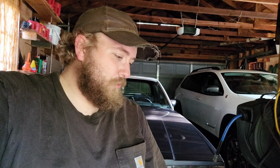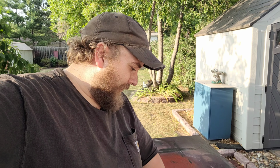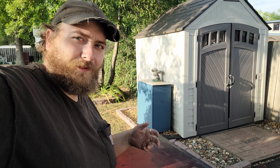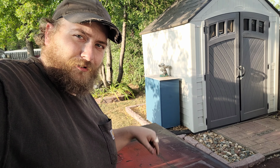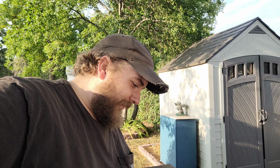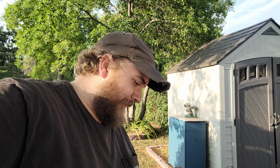But one option that I've been looking into, I don't really know much about it, but just Google searching, right? I mean, they have these valve seat cutter things that you can buy. I imagine you just chuck it up in the old drill, right? It has like essentially a valve stem-ish that goes down through the valve guide to guide it where it needs to cut. I think those are fairly cheap on eBay. That could be an option if those work out the way they're supposed to. I might be able to cut my own valve seats if it's too big of a labor task for the machine shop to get it done with a reasonable budget. So that's another option.